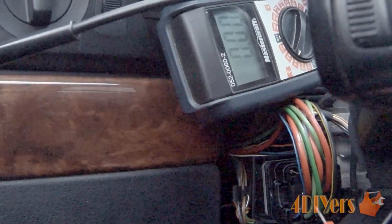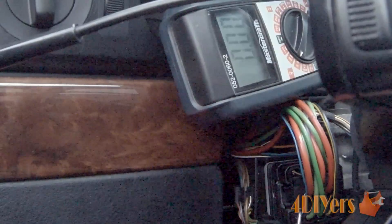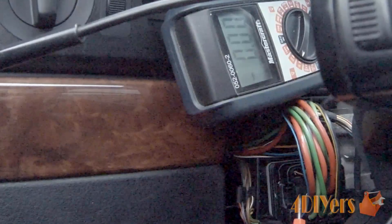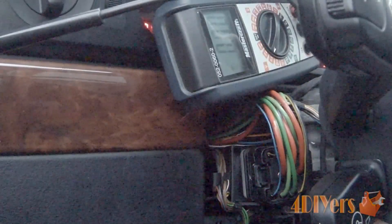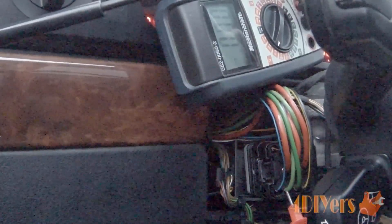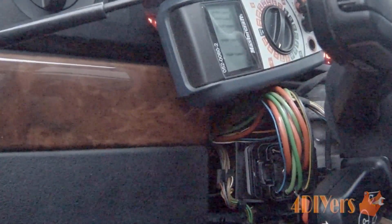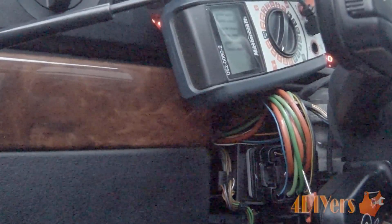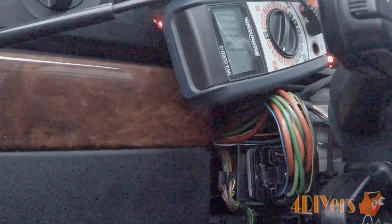You want to go to the other side as well. The two wires on the outside with the lighter gauge are basically just used to tell you when your ignition key is in the ignition — basically an alarm that bongs when you open the door or when you first put your key in. Next, with the key in the on or run position — not the start position — test these wires again, both the three bottom ones and the three top ones. You can see there is voltage at those wires. The three red wires in the center don't need to be checked as they are the main feed in; the ones on the outside are the switched feeds.